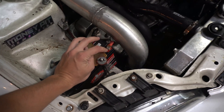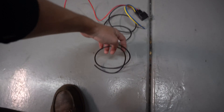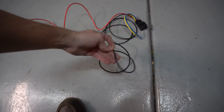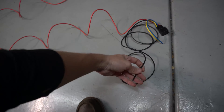The red wire on the battery connects here, runs through the firewall, all the way back to the pump in the rear of the car. The black wire gets grounded — attach it to your chassis somewhere clean with bare metal for a good ground. So we have power coming from the battery and a ground for the relay.